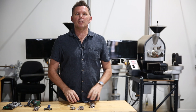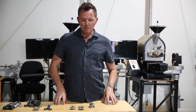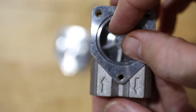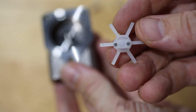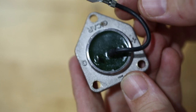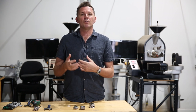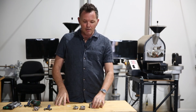One of the problems we typically find on espresso machines is flow meter issues and pulse issues. This is directly related to water quality — calcification build-up. One of the things to check is that these are nice and clean and clear. It may be a case that you simply need to replace the little plastic impeller due to wear and tear, and also making sure this side is clean and clear of any build-up. Finally, look a little bit downstream more towards your group head and check that the flow restrictor itself is not blocked, as back pressure can create faults.